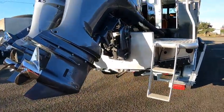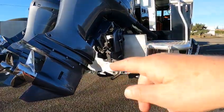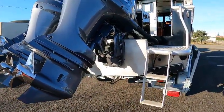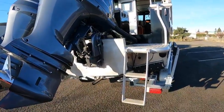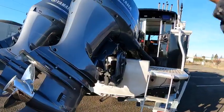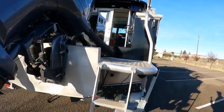And if they're pumping under the water, you get home, you go to put your earmuffs on there, no water comes out, 10 to 1, you don't have water pressure. So don't panic, take it back to the water, dip it in, pours out water, you know you're good. You just maybe would need to put a hose there and a hose on that freshwater flush.